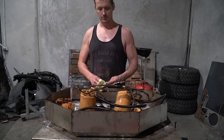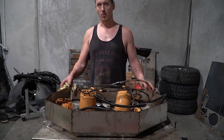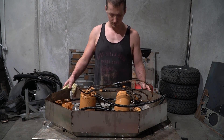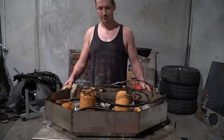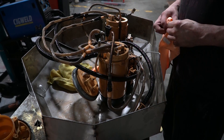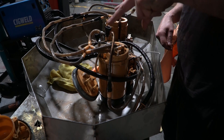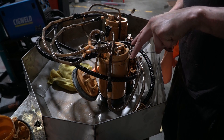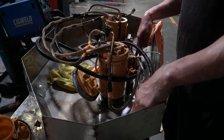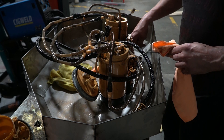It's not as easy as you might think, because there's not that much space to work with. Now while this whole tank might be the same volume as the original one over there, it's in a much more compact form factor. So I'm probably going to have to be a bit creative with how some of these pickup tubes are oriented. After much faffing around, I've got it kind of laid out how it's going to be. These two things here are fuel pickups, and they have to be at a certain angle in the fuel tank. They've got three legs, which means that as long as all three legs are touching the bottom of the fuel tank, they're in the correct position. I've tweaked this little aligning rod on both of them so that they're now located in the right place, with a pickup on each side.